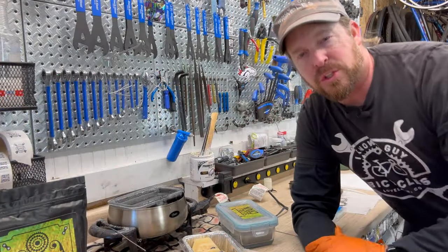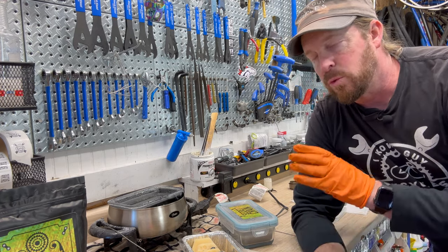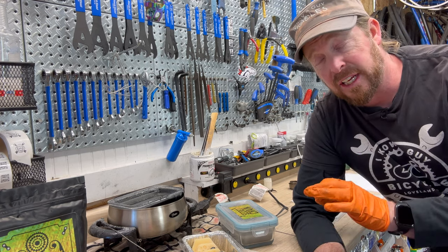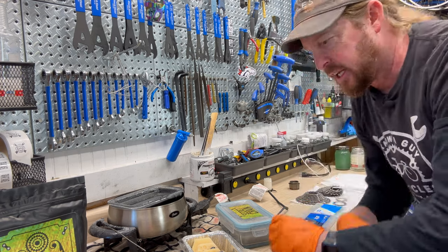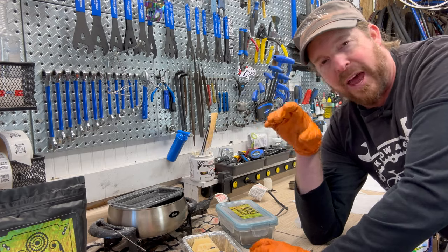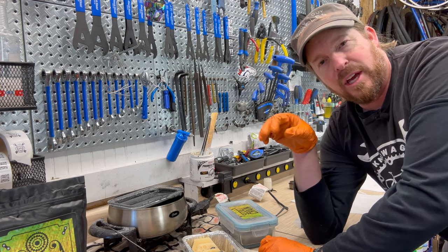So this is what I came up with. You take the new chain or your used chain and you want to thoroughly clean it. Ultrasonic cleaners are probably the best way to do that. What I do is take that chain and put it through three different cycles with a concentrated Simple Green in a bag inside the actual tank. That breaks down all the gunk inside the actual chain itself — and I do that with used or new chains.